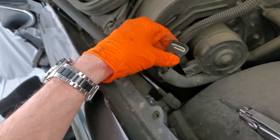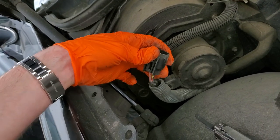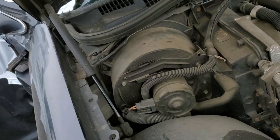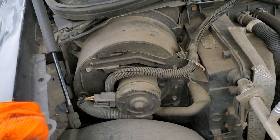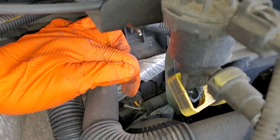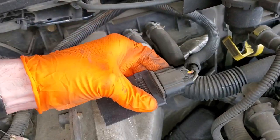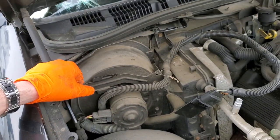The ground side of the circuit is actually how the different speeds are controlled. That orange/black wire — marked with green paint — goes directly to the switch assembly. The switch assembly sends either a direct ground if you have it on high speed, or a weakened ground at the other speeds. The weakened ground comes from the blower motor resistor, which has four wires — one goes directly to ground and the others hook up to the resistor, giving you different resistance values for each speed.